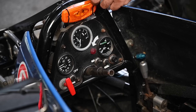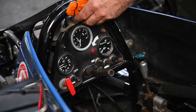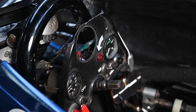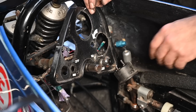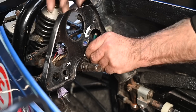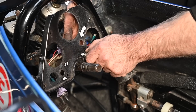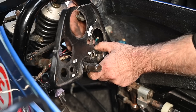Now it's time for the dashboard. I'm going to take note of what I'm disconnecting because otherwise I might forget, and the color code on the cables might not be accurate anymore. The temperature meter and the oil pressure meter are both mechanical types, so they have pipes going to them — you can't put them into a bezel unless you rerun the whole circuit. I have no intention to run this all the way through the car, so I'll have to find another solution. I'm probably going to cut one of the edges open so I can just slide it through, and then fill it back up with something.